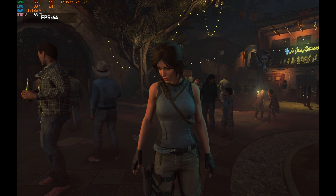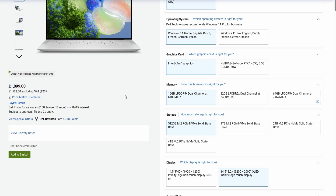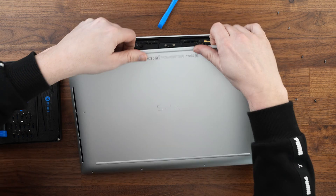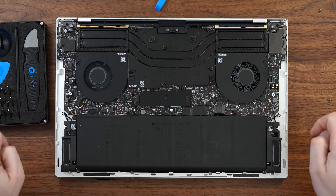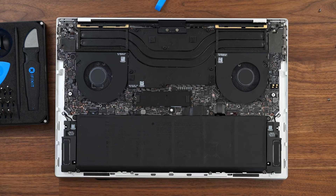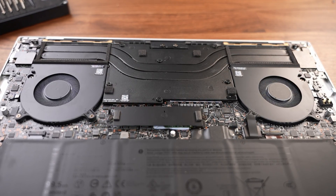Comparing GPUs is slightly more complex. The XPS 14 has Intel Arc integrated graphics or an upgrade to the RTX 4050, whereas the XPS 16 offers Arc, 4050, 4060, or 4070 with vapour chamber. We ordered the 4060 version. If you want ultimate performance, the 4070 with vapour chamber should give you a good 10 to 20 watts more performance over the non-vapour chamber version.